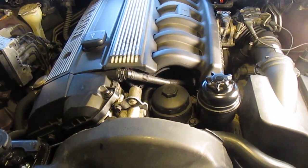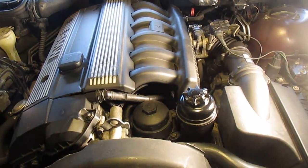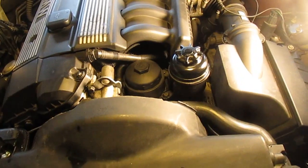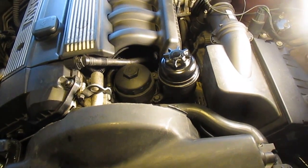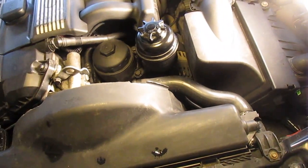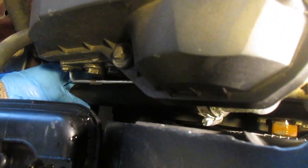This is my project to do a complete cooling system overhaul on this 1998 BMW 528i. The car has been overheating for the past three months. The first time it overheated I replaced the thermostat and the water pump, and that worked for a little bit. Then recently it started overheating again and it actually blew the upper radiator hose. The lower radiator hose is completely cold when the engine is at temperature.